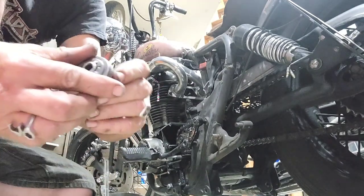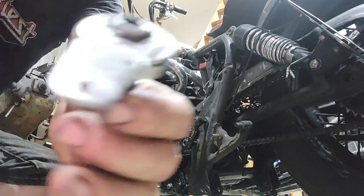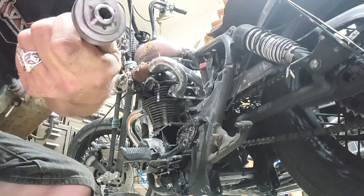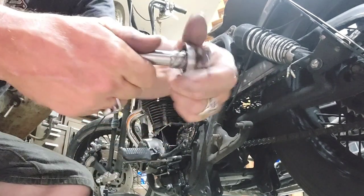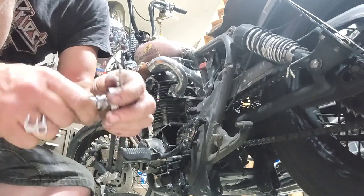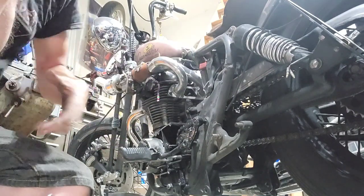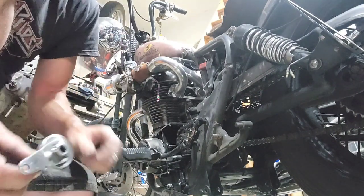The next part I haven't done yet: I'm going to drill in between these threads on here and add a set screw of some kind. If I put some Loctite on this overnight and reef it in tight it should stay. When you push your clutch, it's going to be pushing the removal way — righty tighty, lefty loosey — so it'll go the opposite direction, which is why we need that set screw. I could also do a single little tack weld, and it ain't coming loose, but I want to keep it serviceable.